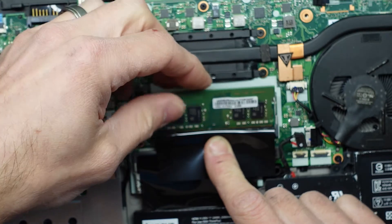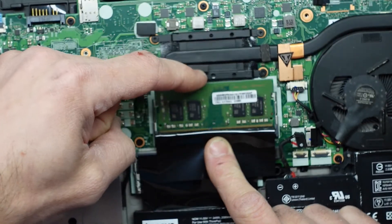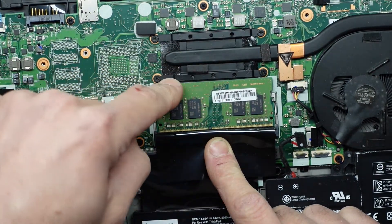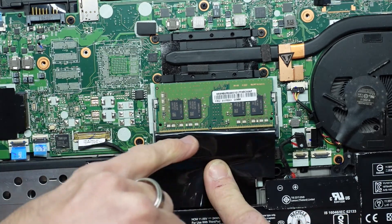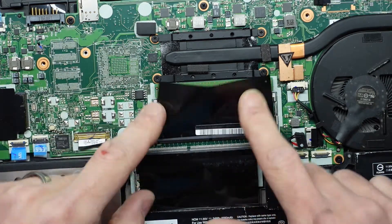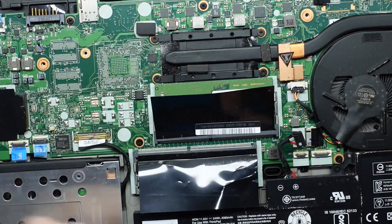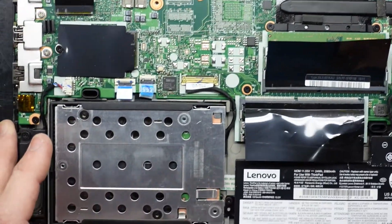Line that notch up, slide it into the gap between the pins, and you should be able to freely move it just up and down. When you're happy with it, push down — it should click into position. Most of the pins should be covered down the bottom; you shouldn't really see too much gold. That'll be the same scenario for the other slot as well. Once you're done, reconnect your battery, turn it on — you don't have to do anything special from there.